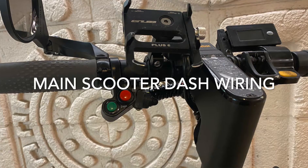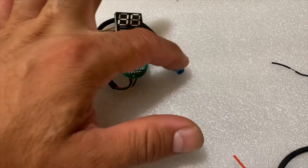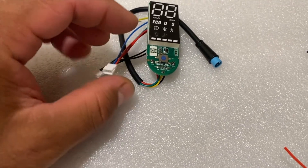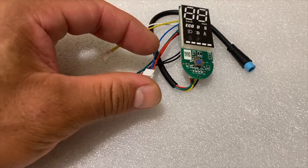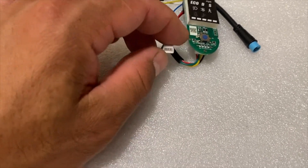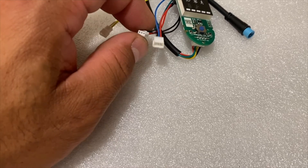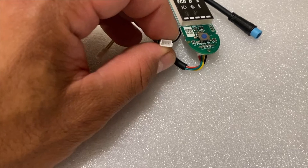In this part, we're going to pretend that this is the main dashboard. So first you're going to unplug your dashboard from the main connection that reaches the controller, and then get this off from the tube that is in the scooter — cancel the wrap with the tube and a zip tie, cut off the zip tie and remove it. Then you're going to be able to see all these connections together right there. So you're going to unplug the throttle, which is this one, and then the brake connector, which is this one over here.